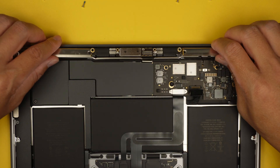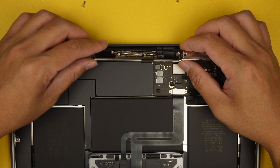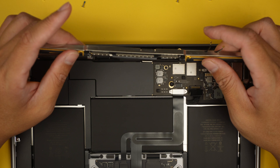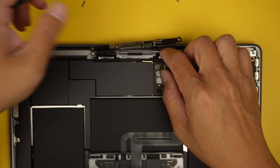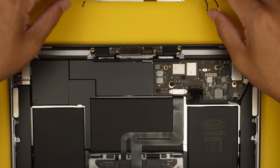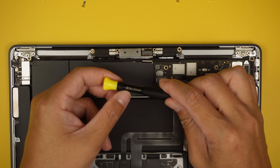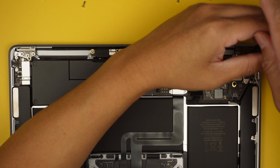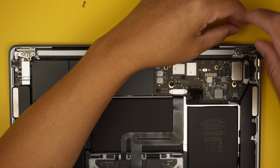You're going to feel a little bit of tension, which is normal because there's a clip holding down the Wi-Fi. Now the component is separated and you just exit the LCD board by lifting straight up. That tape is taping it down to the center of your laptop. Moving on, use a Torx T8 — the yellow screwdriver — to remove three screws holding down the hinge.